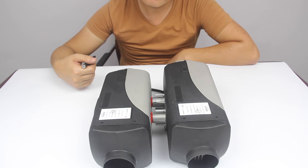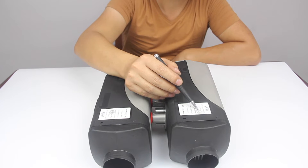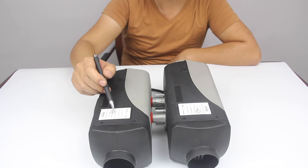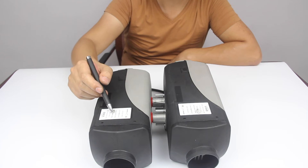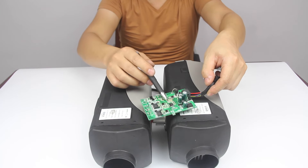To fix area 7, we need to check three places. First, whether the voltage of the parking heater matches that of the vehicle. Second, when you start the car, please check the battery voltage. If your heater is 24V, the normal range should be 18V to 30V. If the heater is 12V, the normal range should be 8V to 15V. Third, please check whether the circuit board is broken.